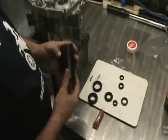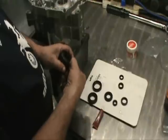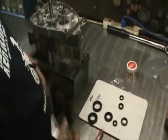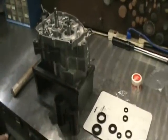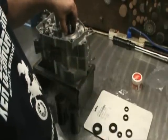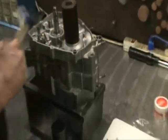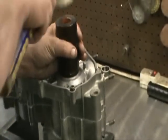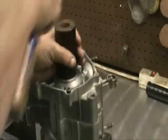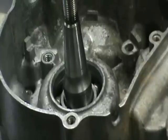We built these drivers from some kind of phenolic plastic material. We've actually cut a recess into it and cut the inner diameter the same size as the crankshaft. We use these specifically for blasters — we do so many of them that we found the need to start making special tools. I get the seal right where it needs to be, take this driver, and drive it home — perfectly square and perfectly recessed.